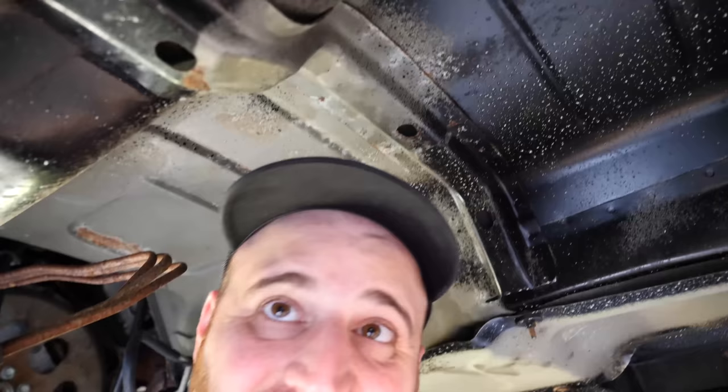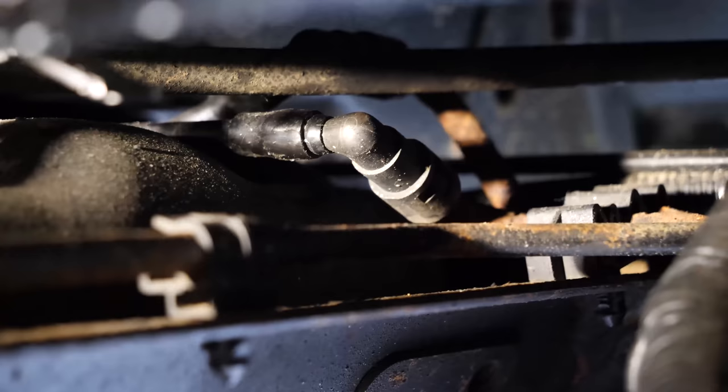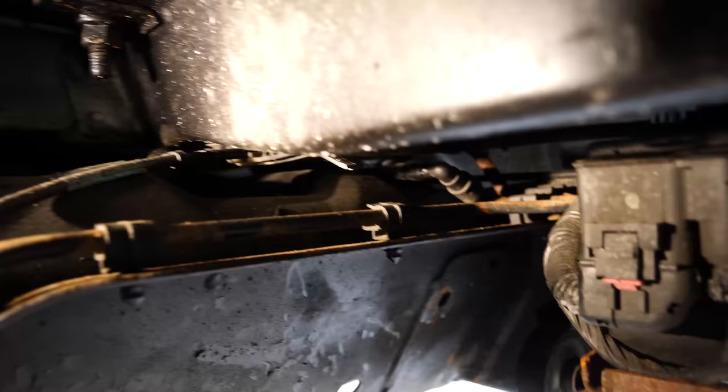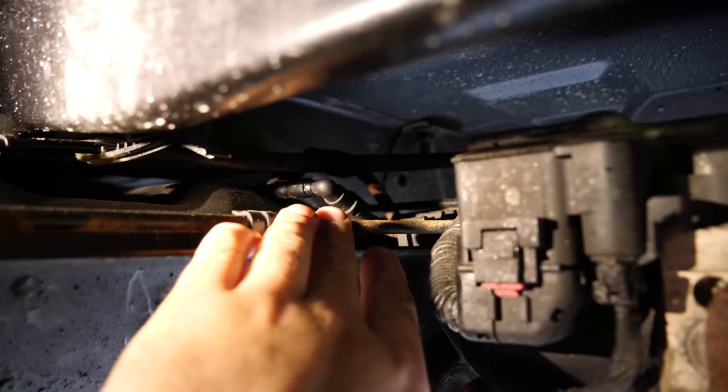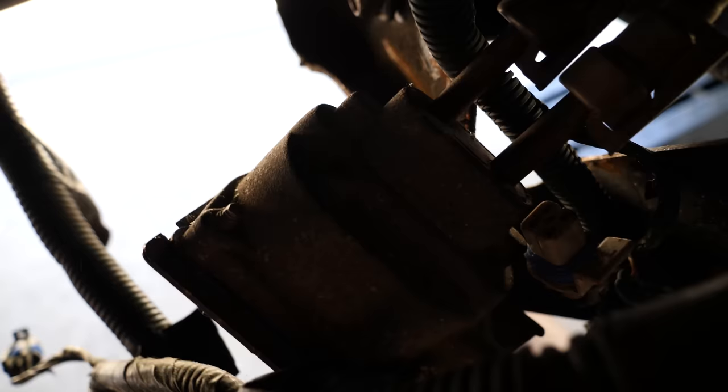You can probably see why this is a little bit easier without a transmission in here — I can just kind of sit under here and get to everything pretty easily. However, if your transmission is still installed, good luck. We've got our feed and our return, and then the EVAP is this guy right here. That just connects right into the canister, which I already got pulled off. So that's the EVAP disconnected — I'll just take it out of these clips. I need to get in there to get those flipped off the hard lines, and then the new ones just have those push-lock fittings and they'll clip right in. And here's Mr. Flex Fuel Sensor — it's going bye-bye.